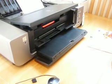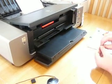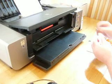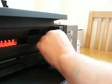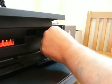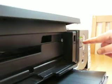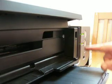At the moment it's not recognised and this is because the printer thinks the lid is still open. In this position here there's a very small sensor — it is detailed in the manual. I've taken one of the small plugs and I'm going to push it in here. When it hits the sensor, the carriage will move back to the right.